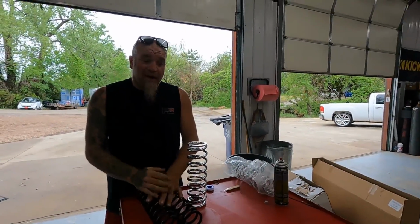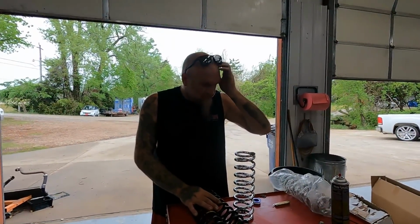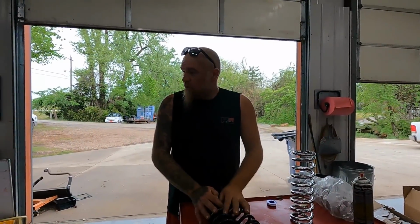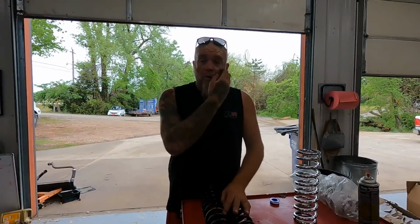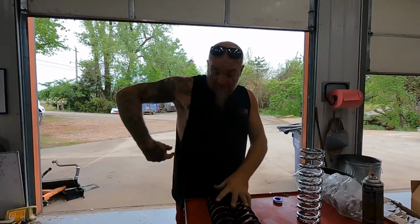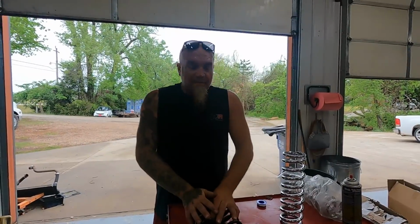Nah. We've already got an 80-pound weight bar in the back right now, so we're going to change out the springs, and there's a reason we're going to change the springs out, and I'll kind of let everybody know. I'm pretty sure, if I remember correctly, the springs on the rear are 130s. I have 150s here because last time we tried to put too much weight in the trunk, the car didn't work. We were in Nebraska, and we kept stacking weight in the trunk, and at some point, you run out of spring.